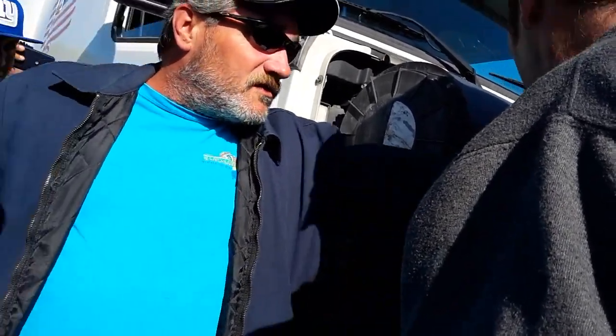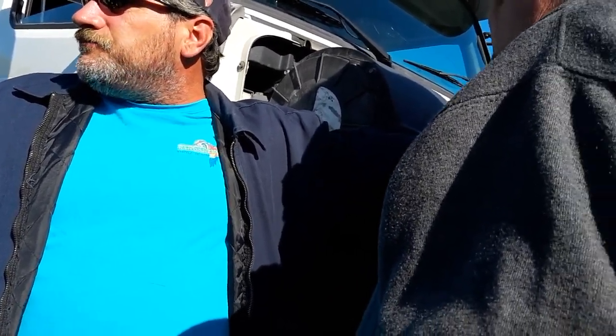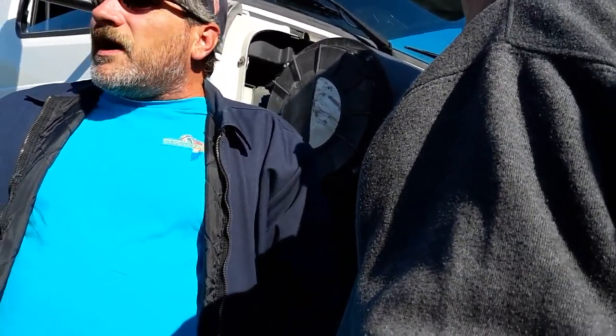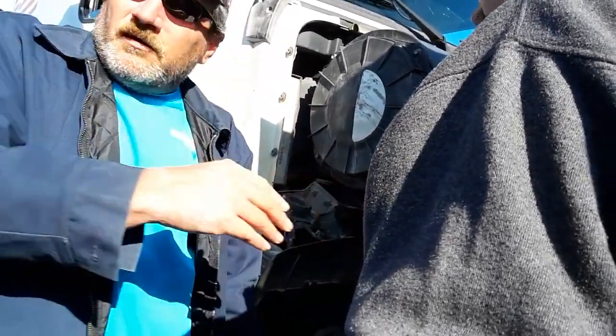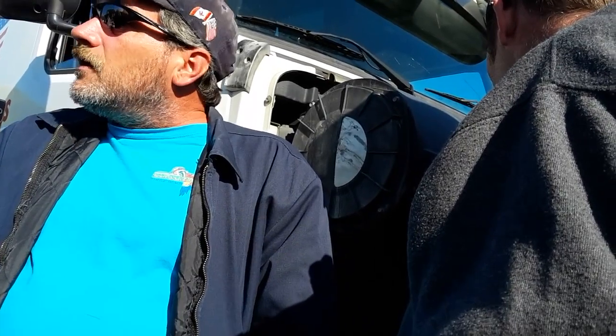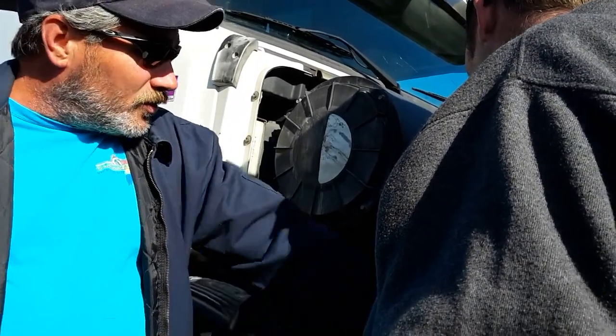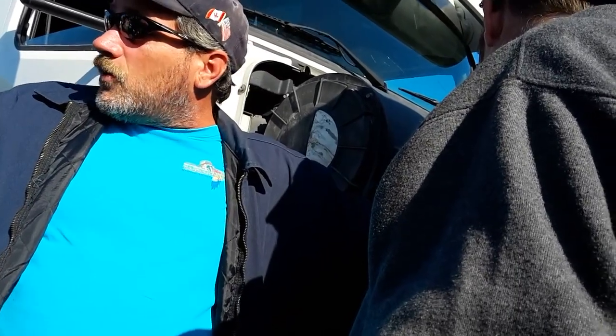He talked about the reservoir. That is universal. It's on all the engines, it's going to be in the same position. Best way to find the water pump, which he was going to go to after the air compressor, that's fine. But the best way to find your water pump would be to follow your hoses. The coolant goes through the water pump, vice versa. If you have any doubt, follow your coolant hoses. That is how you find your water pump.